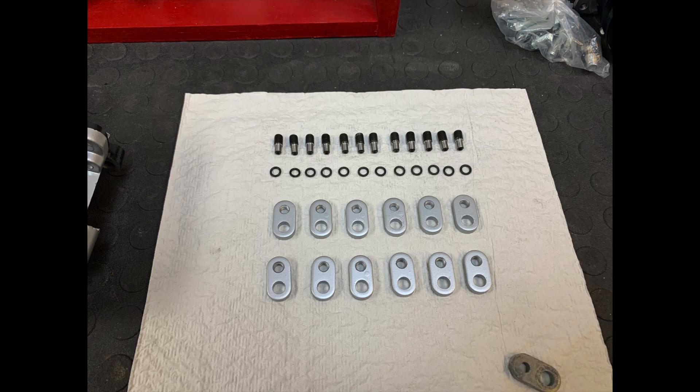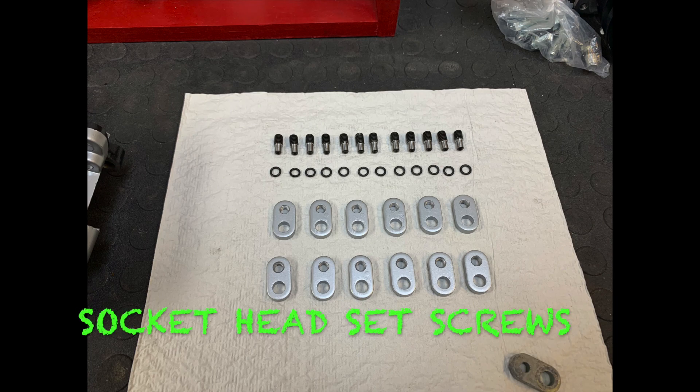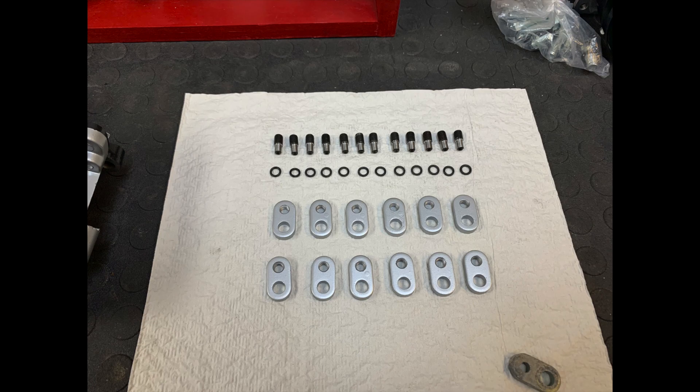At the bottom you can see the oval-shaped seal clamps — the big hole goes over the intake manifold stud and the other end has the air tube pass through it, with a couple of rubber O-rings underneath. What I've done is thread the small hole to 5/16 National Coarse, and the hole itself is the right tap size to do that coincidentally. You need to do that to all 12 of these. Above them you can see 12 O-rings — there should actually be 24 — and above those are 3/4 by 5/16 National Coarse socket head cap screws that have had half of their diameter turned down to the same diameter as the air tube that passes through it ordinarily.